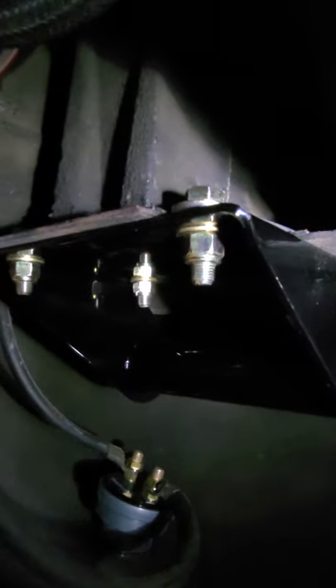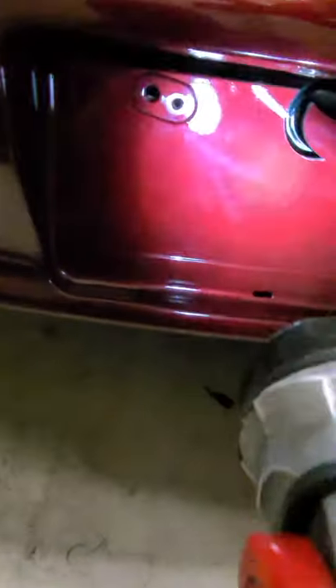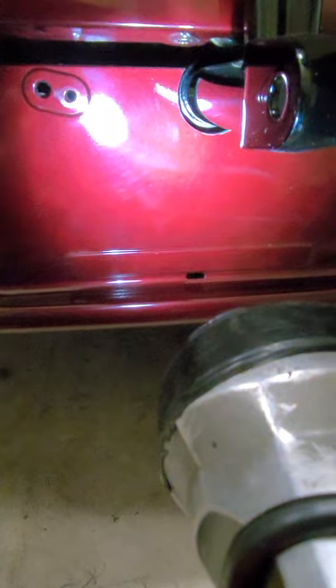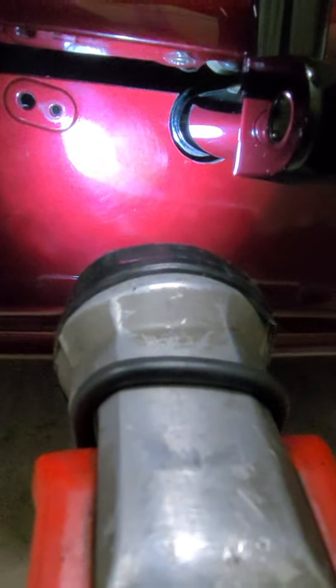It really reminds me of just like a hitch — it basically just bolts up like a hitch. I was able to bolt it in with the bumper cover still intact, which was awesome. The only reason I was able to do that is because the factory bumper was removed. It goes through right underneath your license plate. I marked the center of where it was on the bumper cover, used a two-inch hole saw, drilled the hole through there, and that worked out perfect.